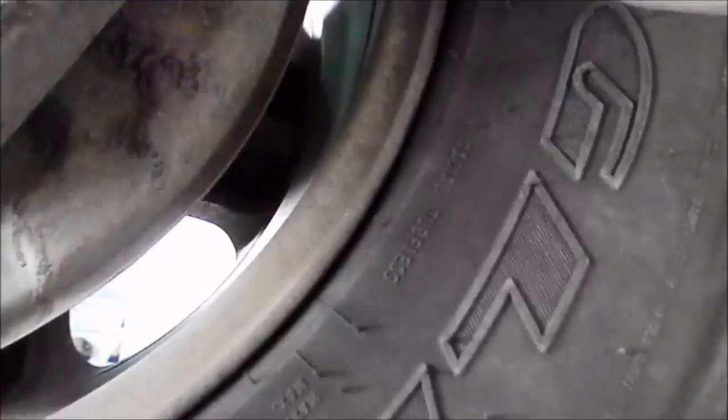You can see how much that moves — that one's easy to rotate because it's not locked in. On this steering bar here we've got a grease nipple. Sometimes they're a bit sneaky and hard to see, but if you get a torch and have a look you'll generally find them all. You can see there's a bit of grease coming out around the seal. These knuckles here are a sealed unit. We'll put the camera down and clean them up and pump a bit of grease into them.